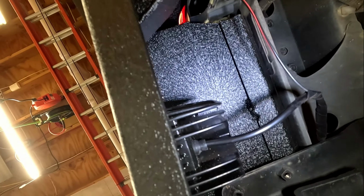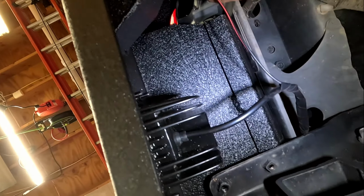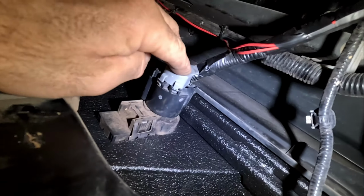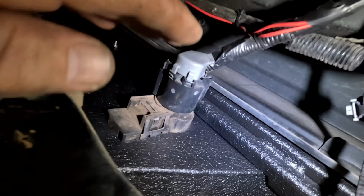All right, so this is the wiring that we are using for the light. Just put my ground, just kind of scraped that off and actually put a nice little grommet there, taped it up, and then tie wrapped it all the way across. Don't be afraid to use tie wraps. Taped it, same thing with this guy. And everything is actually connected through the 7-pin connector.